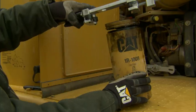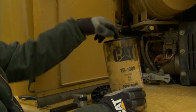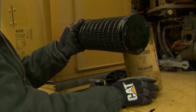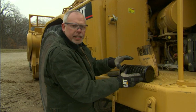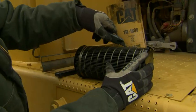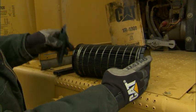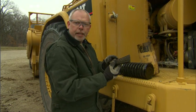Take a filter cutter and you can cut the top off any of our spin-on filters. Top comes off, bring out the cartridge here. We can take a knife and cut down through a section here and through a section, and we'll end up with a piece like this example I have here.